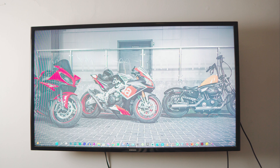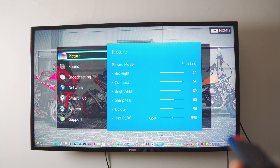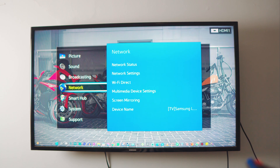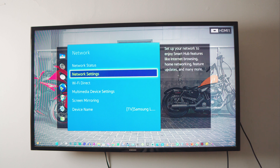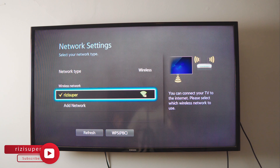Now let's jump into the TV. It doesn't matter what TV you have — this is a non-Android Samsung TV from 12 years ago. The first thing you want to do is head over to your menu settings and go to your network settings. Inside the network, head over to your network status. If you've done this before, clicking network status will automatically connect your TV to your Ethernet cable, Wi-Fi, or hotspot.